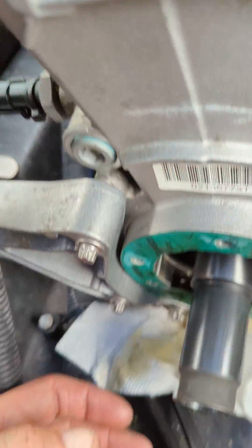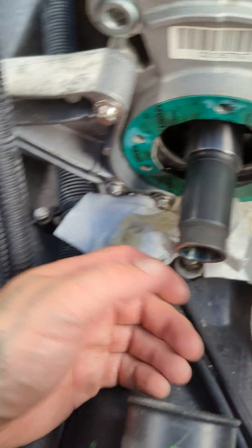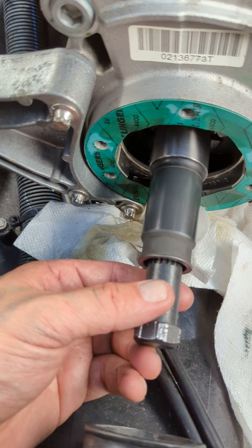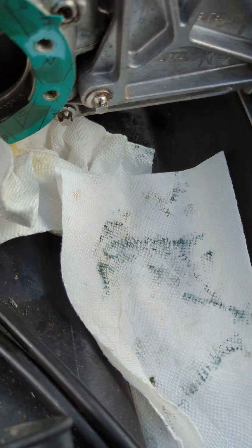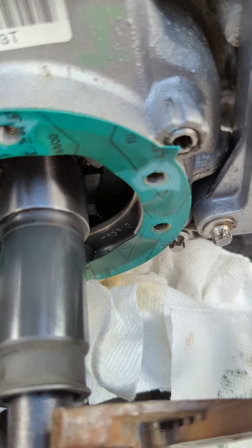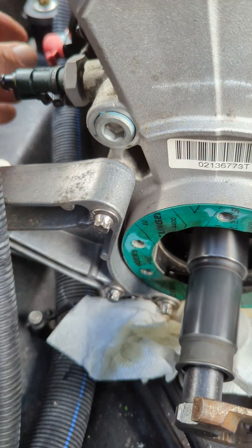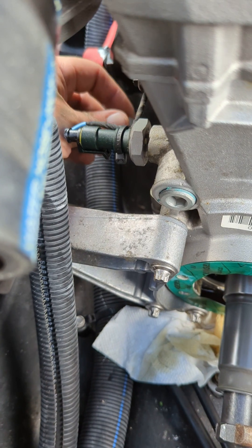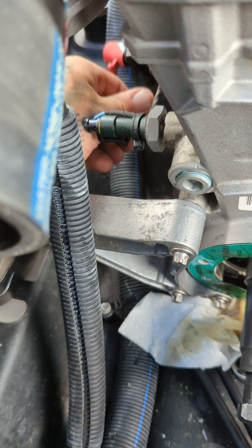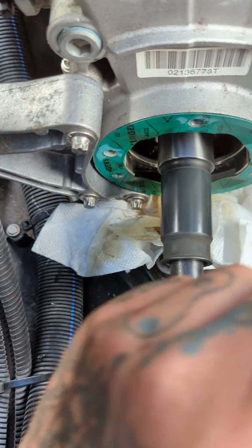There's a divot in there that you need to find. I saw some videos online using a monkey wrench on this or clamping onto your drive shaft, but I struggled with that until I realized the impeller locking tool will fit nicely right in those gears and then you can use a wrench. One hand on the impeller locking tool, one hand on the crankshaft with a wrench — spin it about a millimeter at a time, get the piston all the way at its highest, then keep going back and forth: tighten a little bit, wiggle the wrench, try another spot, until you find that divot. Once you find it, hand-tighten the locking tool as hard as you can and the crankshaft won't move at all.